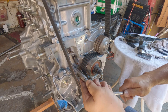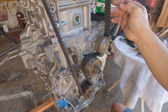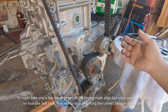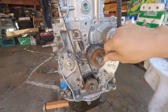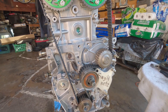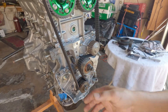Next is the maintenance service bolt. You can see it goes up a little more as it sets. And that's it — the belt tension is set. That's how easy it is. Make sure to tighten the nut again, then torque the maintenance service bolt. I'll turn it again and recheck.